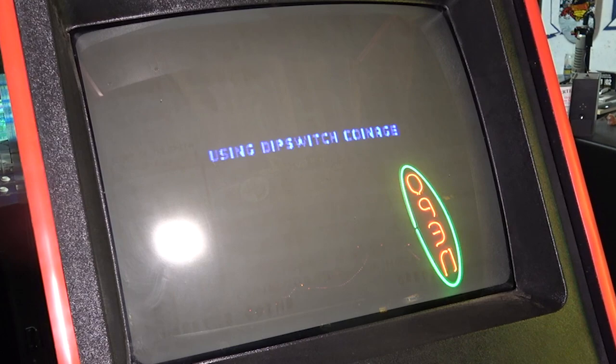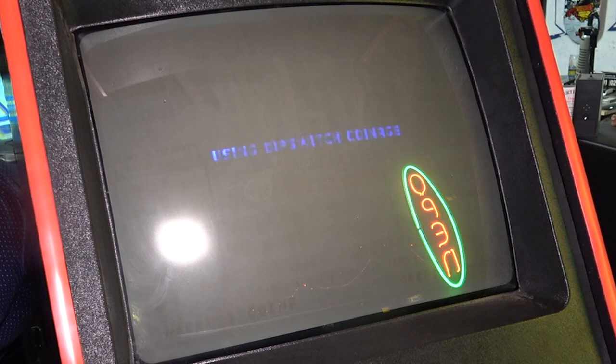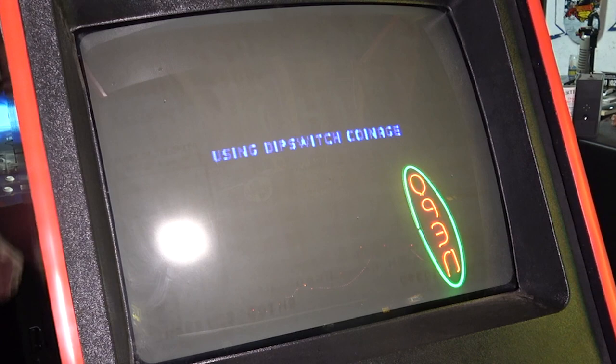And then number three, I only see blue. Is this a simple monitor adjustment in the back of the neck board? I don't know. I need to get my mirror because I can't really get to the color pots right now. This monitor doesn't have the colors on here, does it? And that's another issue, this thing is all frinky. So we gotta adjust the monitor, but I will worry about that way later.